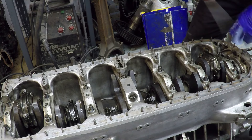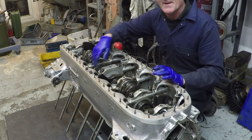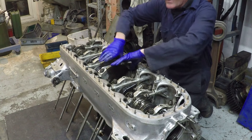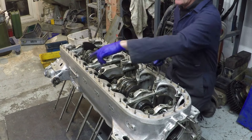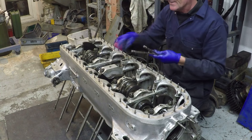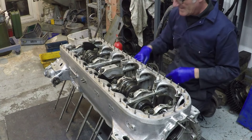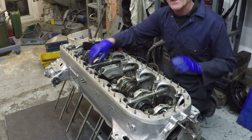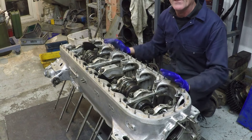I'll get them to torque all these up, get the oil gallery fitted, and then we can move on to the large crankcase. That's all the main bearing caps torqued up to 80 pounds feet, and we'll just check that the crank still moves freely — which it does. Before I put the split pins in, this engine is also cross-bolted — they call them lateral bolts — and each main bearing cap has two of these running through. I'll put them in and torque them up to 23 pounds feet, then just make sure the crankshaft still turns freely, before putting the split pins in those and then the split pins in the lateral bolts. And the job's a good one.